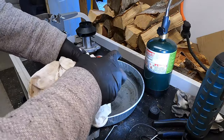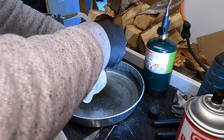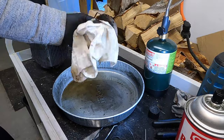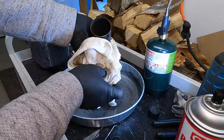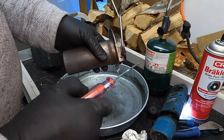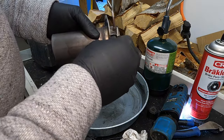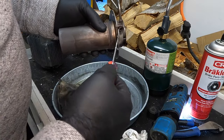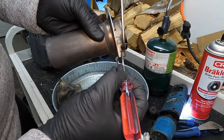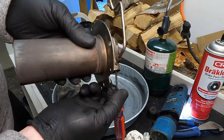This really needed a thorough cleaning — that's what I'm learning from this. It was just super full of debris and carbon, and there was really no chance it was going to work correctly without a significant cleaning. One note on reassembly: you want to make sure that when you put this screen back in, it doesn't occlude this little air inlet hole, otherwise you will not get good combustion. That has to be tucked in all the way down into there, so you can confirm it's nice and clear — you can run your pick through it.